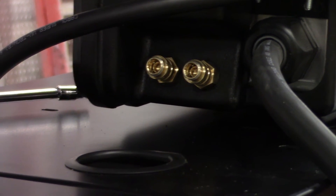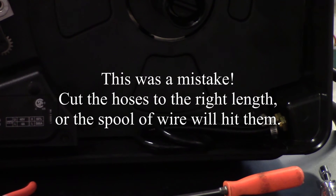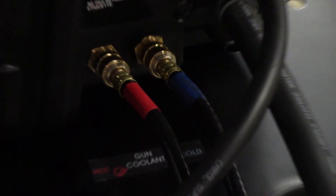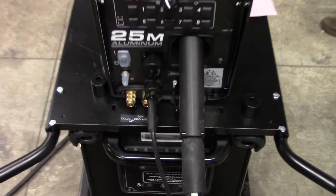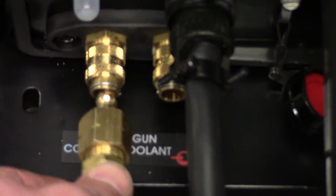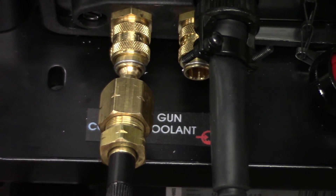Now we're going to connect all this stuff to the water cooler. We just put the plate back in and you can see the hoses — it barely fits out that bottom thing. What a pain that was. Now we're going to go ahead and connect the front. There's a special little nut that goes on to get it into the quick connects. These are the back quick connects all hooked up. We're going to go to the front where we ran into yet another problem. This is the front of the machine — you can see you are not going to be able to get that to go in there without hitting this lip. So we're going to have to readjust — just unhook it from the tray, move it back for now and worry about it later.